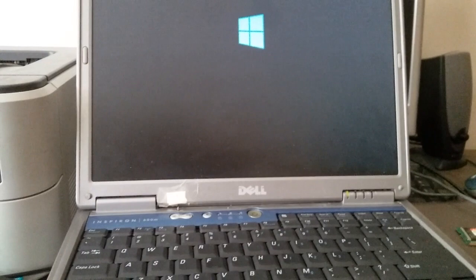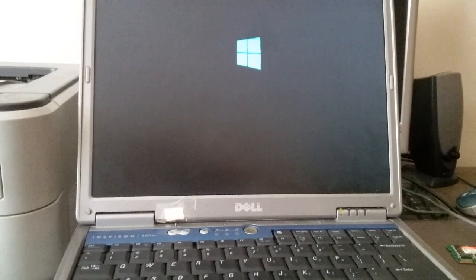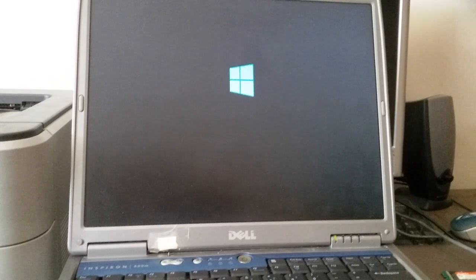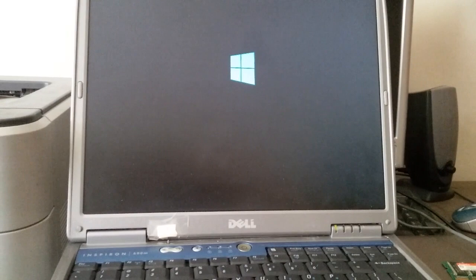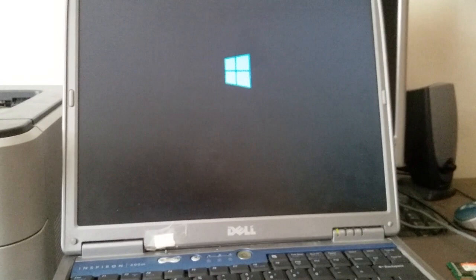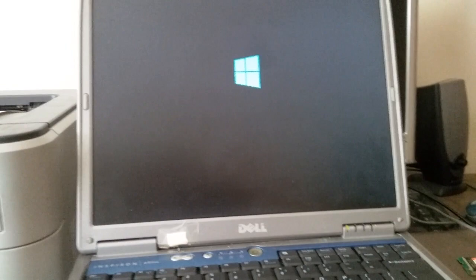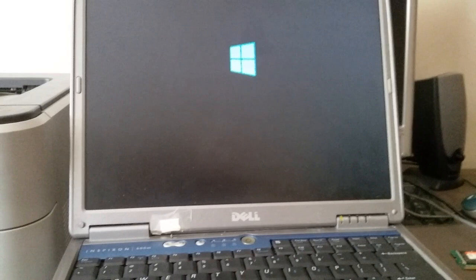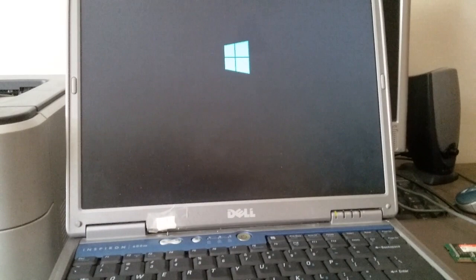Oh, and as with the other video about the 8400, I added it to the video description, just in case anybody saw that, about my choice to use 32-bit Windows 10. It wouldn't run 64-bit anyway, because it's missing VTX. I actually did try to install it, and it would give me this screen, and before the circle would appear, it would just reboot.